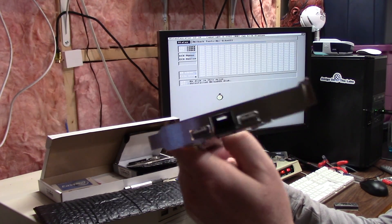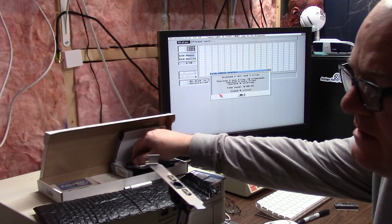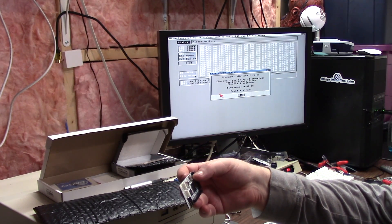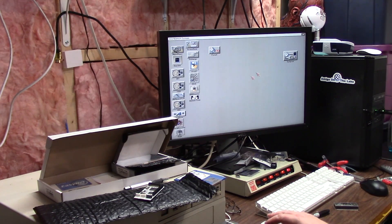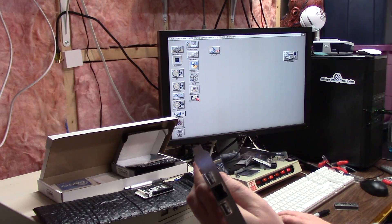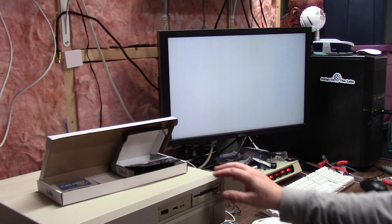The card comes with one RJ45 and two USBs, but apparently the USBs don't work until you plug this thing in — then you get some more plugs which look like double Molex plugs. I'm not going to run those because I've heard bad things about people blowing up their drives or blowing up this board. So I'm not even going to power it — I'll run a hub if I need to run powered devices.